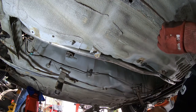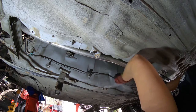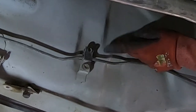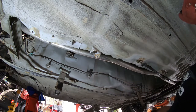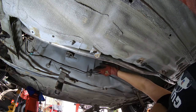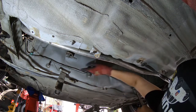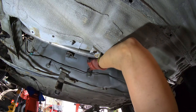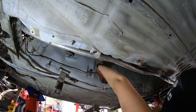This is great because I've got the clutch hard line and I've been trying to work out where it would go, thinking it must coincide with this little brake line — and it does. This bolt that connects the brake line has a second loop up here that I assume the manual line goes through. The hard line clips the guy gave me are identical, and the hard line sits on the top notch, so all I need to do is attach the manual line to the top of these and figure out which way is front and which is back, then route it to the front and rear of the car. That makes life hella easy.